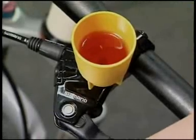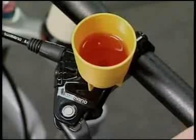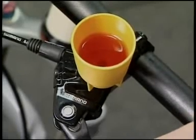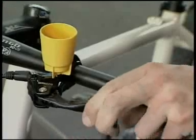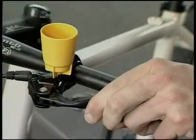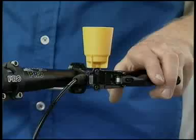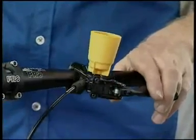If the brake lever is then operated, air bubbles in the system will rise up through the port into the oil funnel. Once the bubbles stop appearing, depress the brake lever as far as it'll go. The normal condition is for the lever to be stiff at this point. Check that there are no bubbles left inside the reservoir tank.